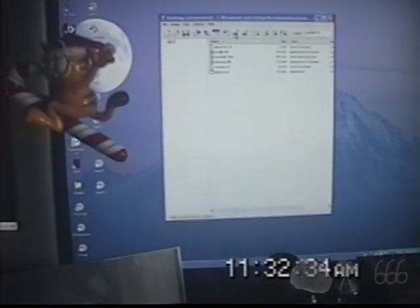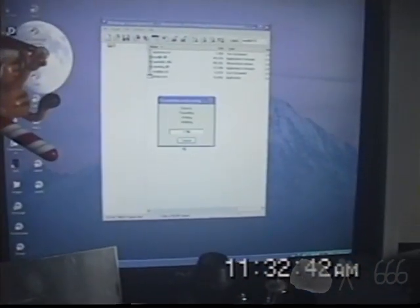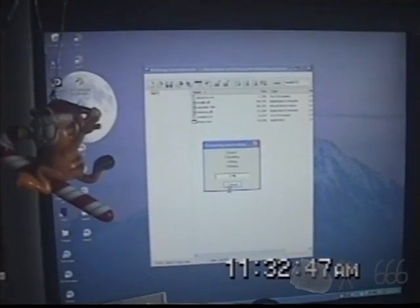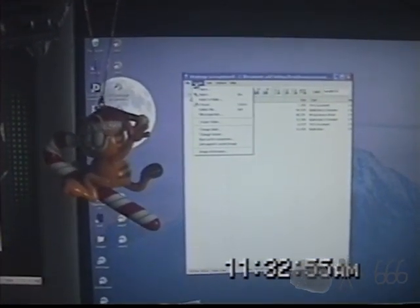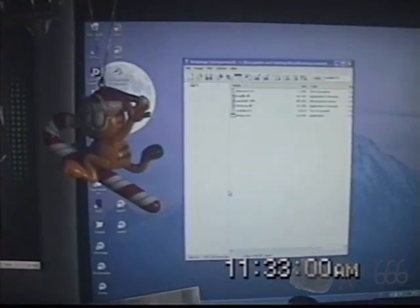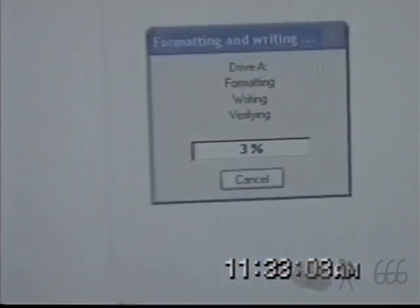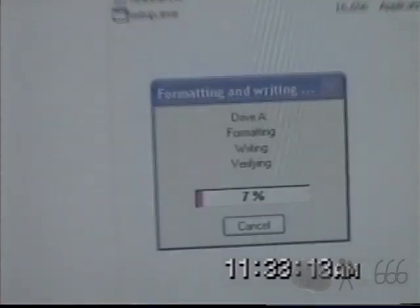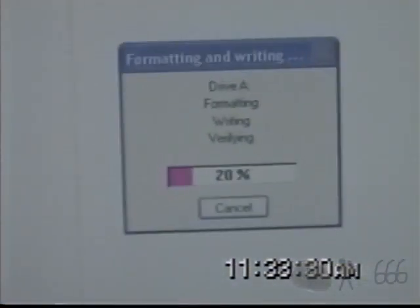So my program is apparently flaking out, which probably means I've replaced a floppy drive that there really wasn't anything wrong with. I think I know what happened — I probably replaced a floppy drive that there was nothing wrong with. It was probably actually set for 720K, which of course won't work because the track alignment is different. So yeah, I probably just replaced a floppy drive that there really wasn't anything wrong with. Oh well, you got a video out of it — I wouldn't complain too much as a viewer. It's just that I wasted my time.